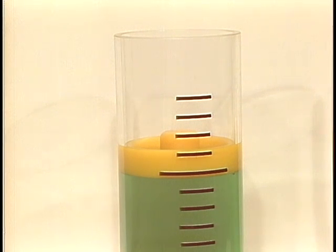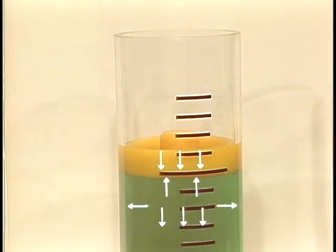First, let's look at basic principles of hydraulic systems because these control everything that happens in hydraulic brake systems. Under normal pressures, liquid cannot be compressed. This heavyweight, for example, cannot press the liquid down beyond its original level. It is, however, putting force on the liquid. This force acts in all directions, putting pressure on the weight itself and on the walls and floor of the container. The pressure is the same at all points.